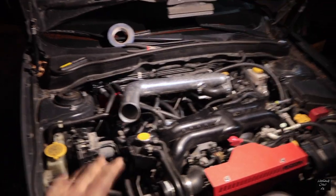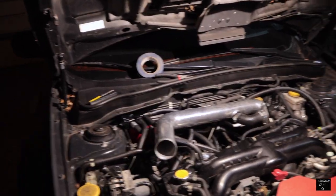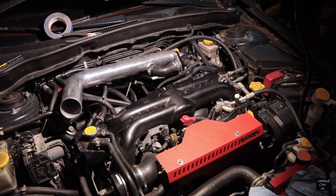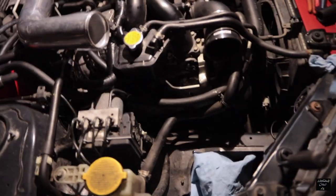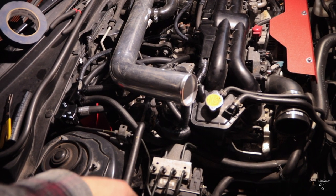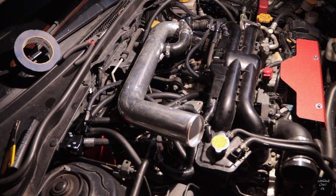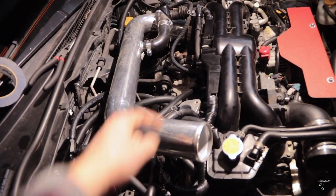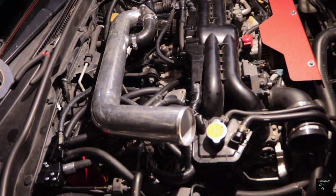This is finally finished — everything is routed where it has to go. I still need to put everything back but the lines are done. It was incredibly difficult. There's not a lot of space, you really need patience, and it takes a long time. The little lines behind the intake manifold, the wiring harness — all very tight. Just follow the directions and you'll find it a little easier, but there are tricky spots. One thing: a line going under the intake manifold comes pre-assembled in the kit, even though the directions have you assemble it differently — just little things like that to watch for.